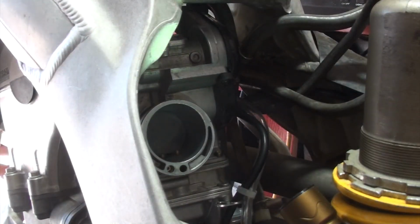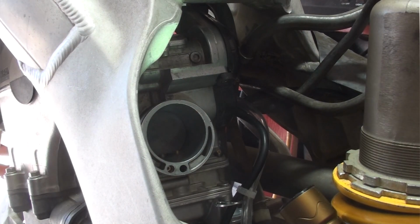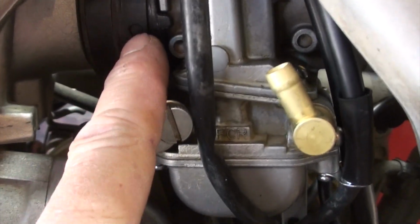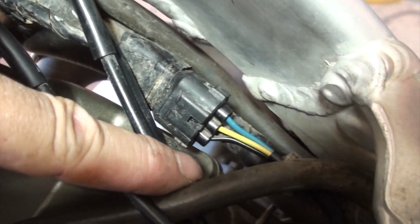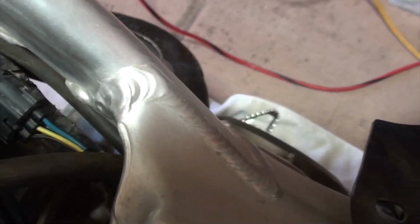Okay. Now we're in. All right, so let's review really quick. So we seated the carburetor back into the boot. We tightened down this clamp. We then connected the electrical, which is right here, connected that clip, and then we just put the throttle cables together. So I'm gonna move this really quick and take this air relief and just take it off the top of the throttle cables. So there's the throttle cable connections, and we put the plastic protector, or whatever you call it, this thing back on the throttle pieces.